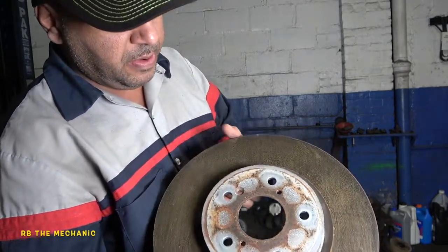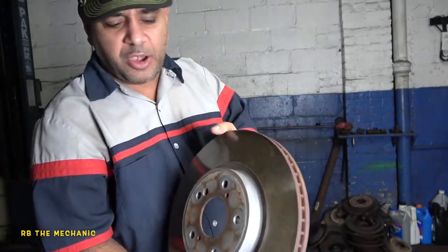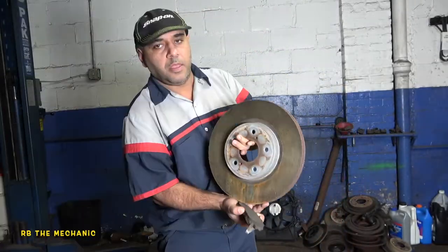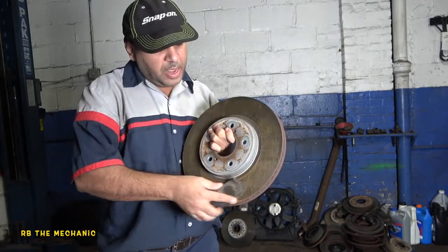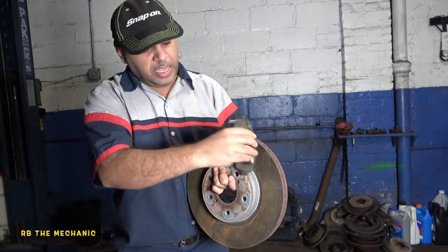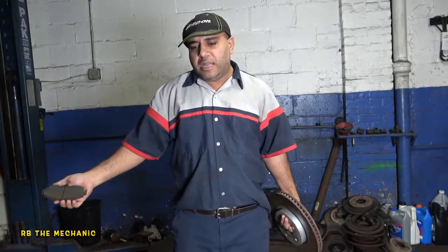These rotors are originally coated in the vents area, the hub area, and internally. Anyway, what's the process — how do you get rid of this rust? It's a simple solution: you really don't have to do anything. Take your car out for a spin. When that disc spins, it's gonna clean out your rotor — it's gonna smack all that rust and corrosion right off.